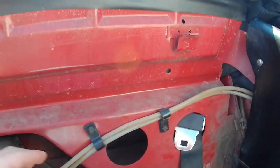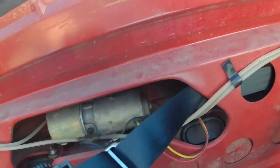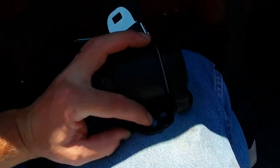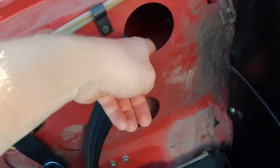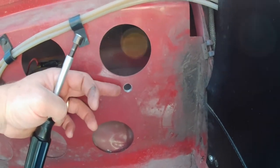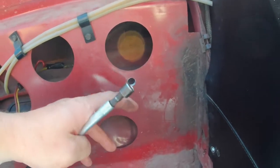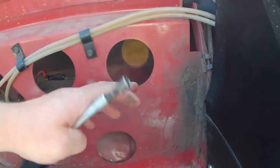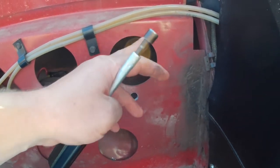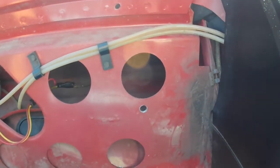We need to attach the mechanism. The mechanism is only held on by one bolt — we're going to use that center hole right there, and there's enough room when that sits back here; there's like an inch and a half probably. I just kind of felt around in there, put my finger on the back of that plate, eyeballed it by feel for the drill, and drilled that hole. Hole looks like it's going to line up real well with that mechanism. It just kind of drags right here and right here a little bit — the webbing does. It's probably okay, but it's a seat belt, so there ain't no sense in taking no chances.